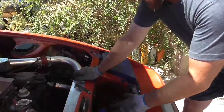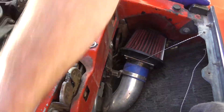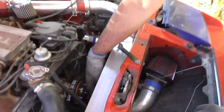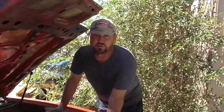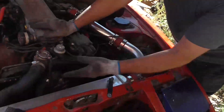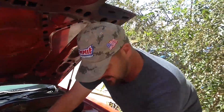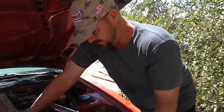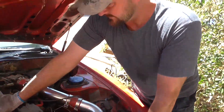After the air filter is taken out, there's a huge duct that takes this whole space away. There's also a huge radiator shroud and a huge mechanical fan, which I took all that out because I wanted to go electric fan. The mechanical fan took up all this space. With the electric fan, you eliminate a lot of unnecessary stuff and make room for all this extra equipment — room for intake, room for intercooler, room for tubing.